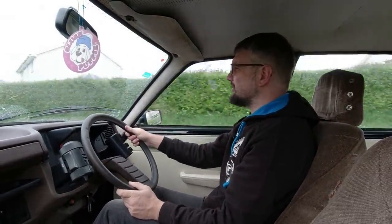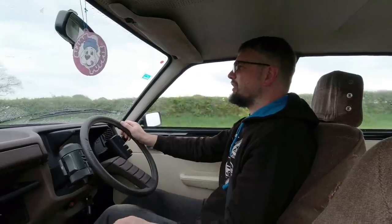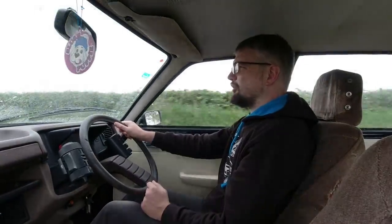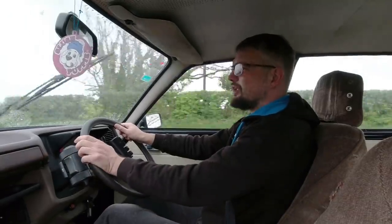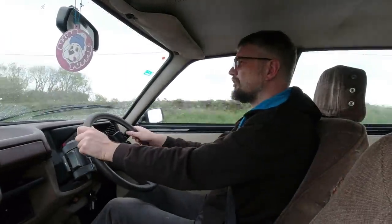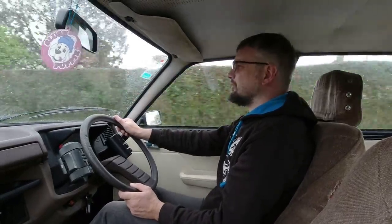We shall carry on to the unit and load up on stuff, including tools. I'll try to find a multimeter so I can investigate this alternator light, because it's definitely charging. I haven't smelt eggy battery so I don't think it's overcharging. Apparently it can have diode issues on the alternator. It's frustrating being so far away from my tools. The weather has now turned - it's quite wet - so that also ruins tinkering. Well, since I got back from Australia which is about eight or nine weeks ago the weather has been incredible, so it's actually refreshing to have a bit of rain. But rain after so long means greasy road surfaces - another reason for taking it slightly easy today.